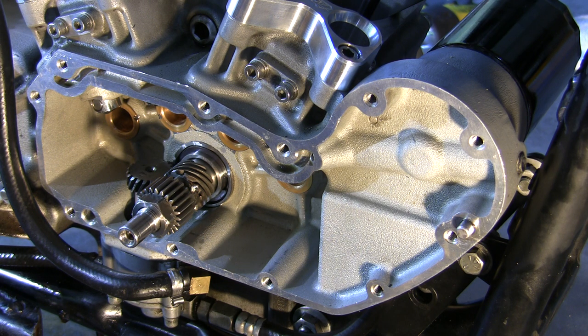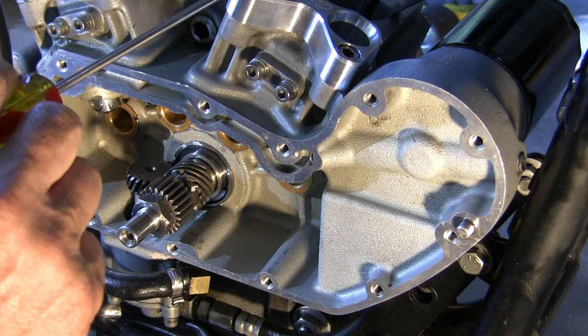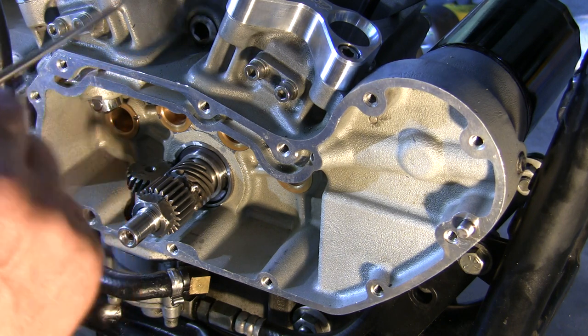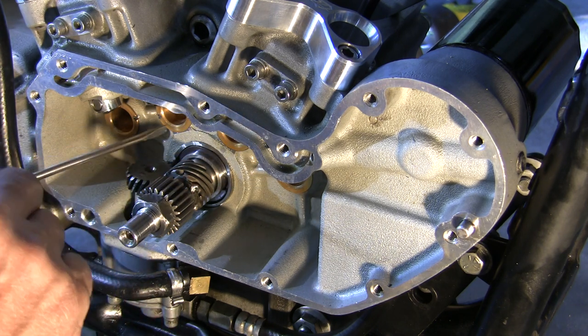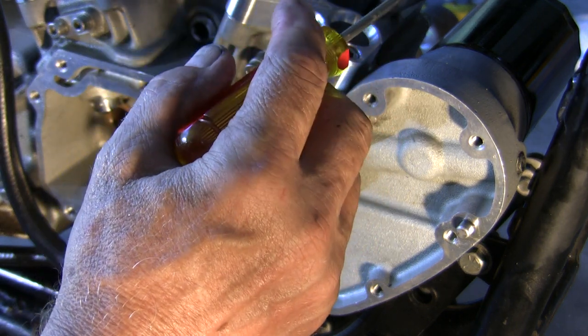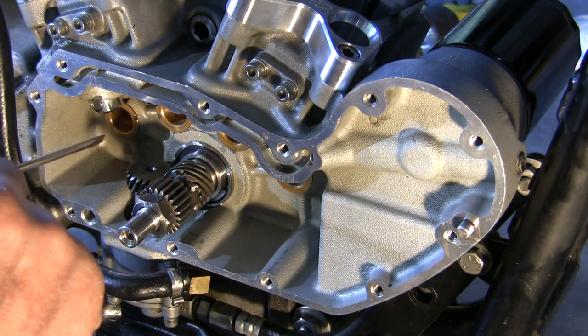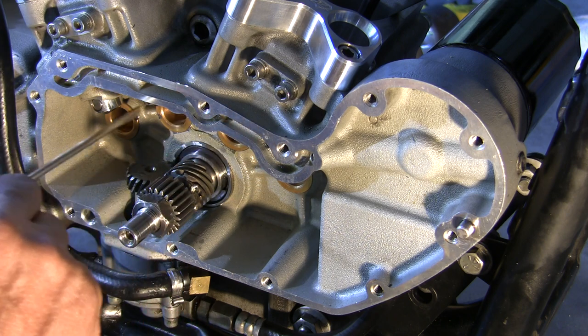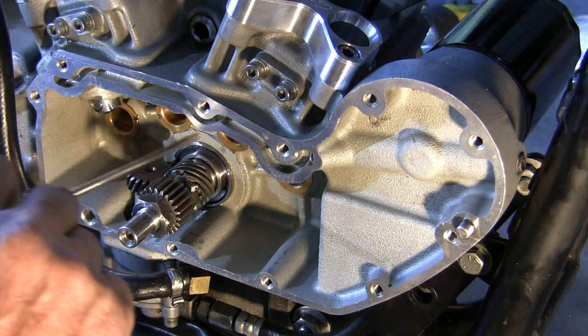You change the angle — Dan and Aaron are doing a lot of neat stuff out there. I have the lifters in this bike, so we're going to have to lift them as I'm putting the cams in. It has the Zipper lifter blocks, extension blocks, and the tubes. I had Dark Horse balance the bottom end and shave the wheels, put the rods in it. They also shaved the cases and bushings a little for the lift on the cams, so that the big-lift cams don't hit the case.